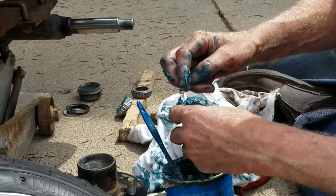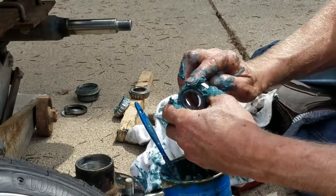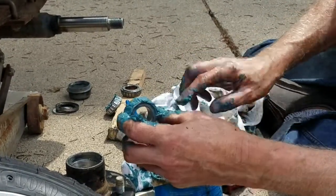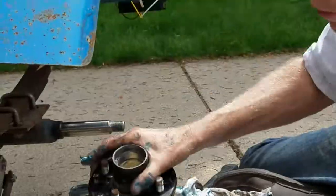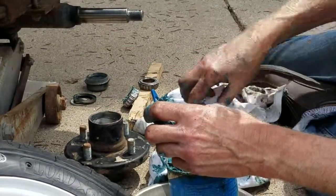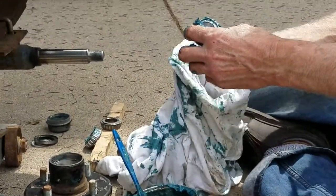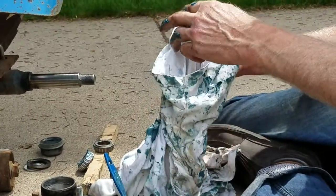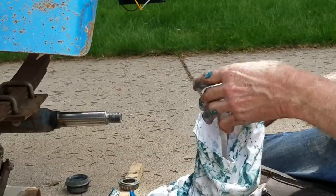You can see you have to pack bearings. You have to get the grease into the bearings. With these Bearing Buddies, where you pump the grease in, all it does is go down the middle like this and sit there and harden up. It doesn't make its way to the bearings. The Bearing Buddy is just useless. As far as I am concerned, I'd much rather take the time and pack it and know what's going on with my bearings than rely on pumping it into a hole.